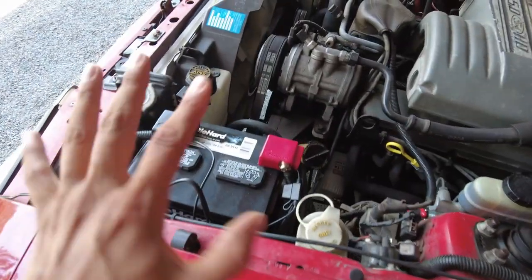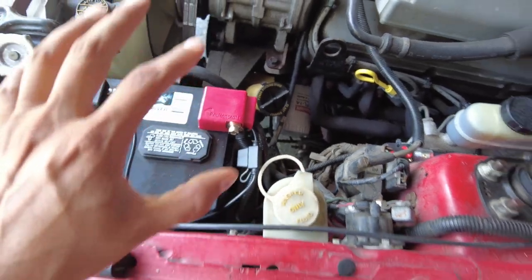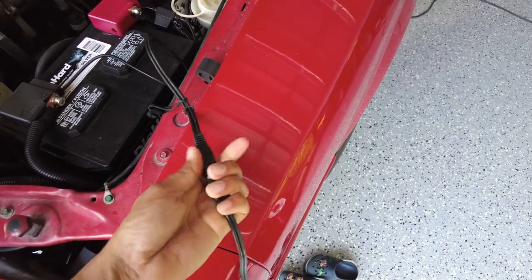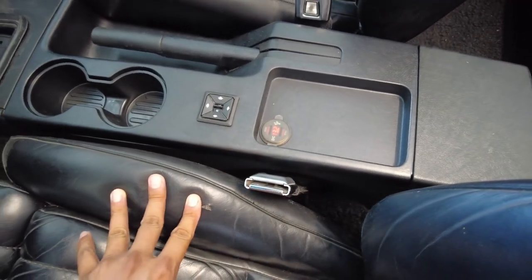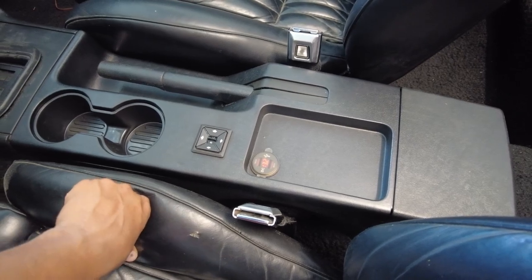It's not true, especially since I am hooked up to the wall and it's plugged right into my car. That's another advantage for the new concepts battery terminals — I have a permanent add-on spot for my battery tender. There's my battery tender down there. So if we disconnect this we should be able to see the voltage drop down to the 12s. There we go, completely disconnected. The voltage has begun its descent, going to 13.2 and it will keep dropping down to about 12-point-something. This will never actually kill the battery of the vehicle — this never turns off. You could get it to turn off if you wired a switch to it, but I didn't want to do that.